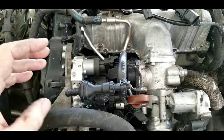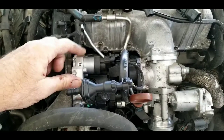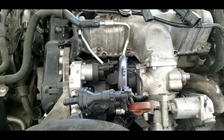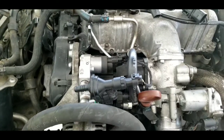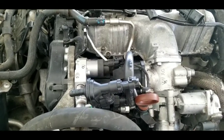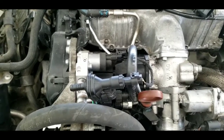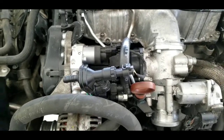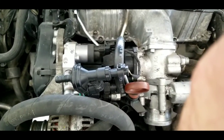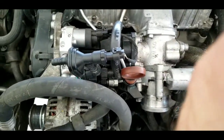On a Ford it's pretty expensive to replace the whole fuel system — that's why I don't own any of the 6.7s. They have that problem and there's no easy fix. On this car and on the Duramax, once you do the CP3 conversion, you're pretty much bulletproofed. So anyway, that's a little bit about the CP3 and the high-pressure fuel system for the Duramax, Ford, and Volkswagen — they all use Bosch pumps. Please like, share, and subscribe. The best fix is just to do this conversion and you're done.